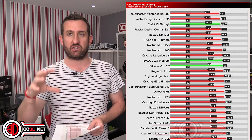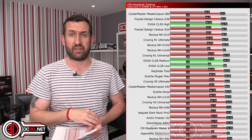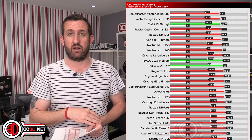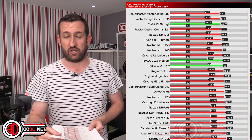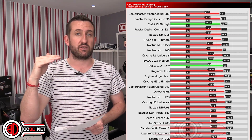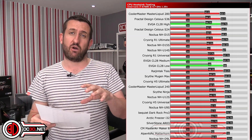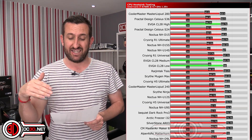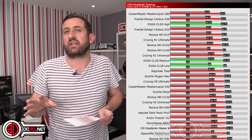If you're running an incredibly hot CPU — like an older 2011-socket chip dumping a lot of heat — a slightly faster fluid flow may help slightly. What I normally do with AIO pumps is tune them to find the quietest point and leave it there, because sometimes the lowest setting isn't the quietest. The key finding from this graph is something quite surprising: the drop from medium fans to low fans was only 0.25 of a degree — literally next to nothing.